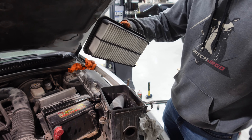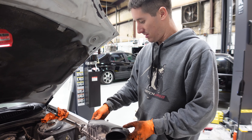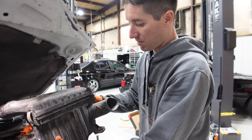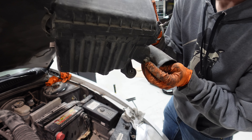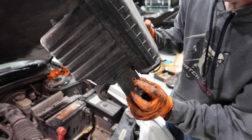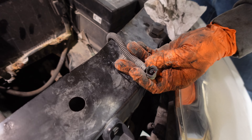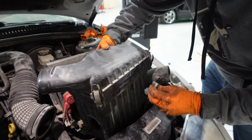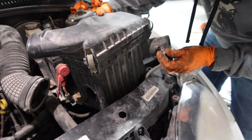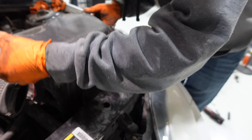I figured we'd check the air filter and it actually looks incredible, so I'm a little impressed. One of the cool, crazy things about this car — these look like hose connections and they're not; these are power connections. This is the intake air temp right there, and it's keyed and really hard to plug in. You have to kind of wiggle and push — and don't be wrong, because you don't get too many chances to put this back together. There it is — in we go.